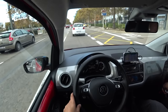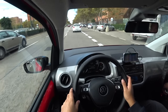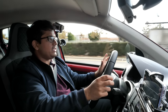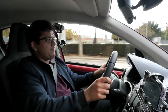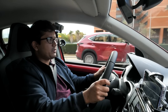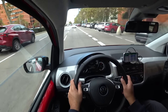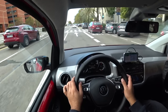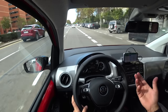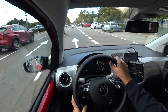the accelerator pedal. So with that, I have the gauges, which tell me on the left-hand side when I am generating more charge with this recuperation. So it's really useful. Right now it says I'm getting 16.3 kilowatt hours per 100 kilometers as the consumption, which is higher than the WLTP rated figure. But the truth is, we had this parked out with the lights on and we were loading things in and out and getting pictures and filming. So you can expect numbers around 14, 14.5, I would say.